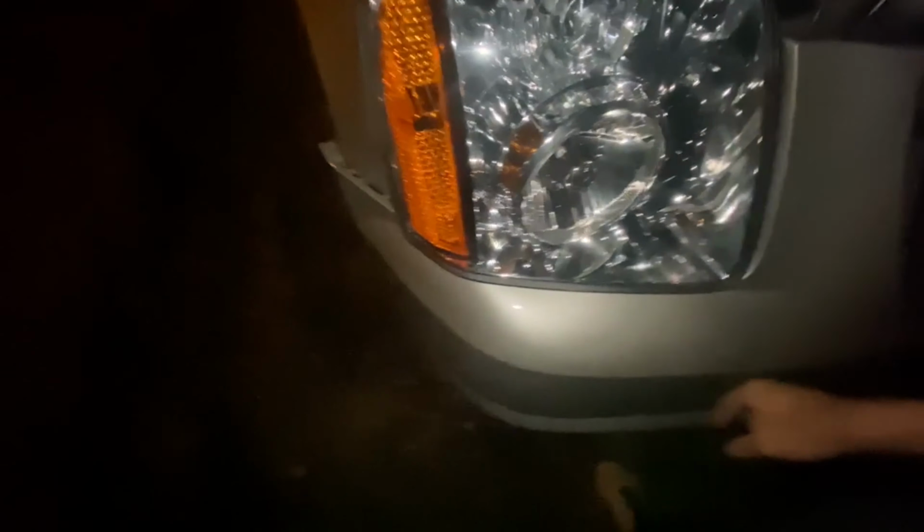So yeah. All right, boys, so after a good little time, got the grill pretty loose. This one is clear. We're coming over here. Bam, got this headlight out. So you gotta go in here, take a little 7mm bolt out there. The rest are 10mm right here and here. If you see in here, there's also that one bolt that's hanging there. It connects to the headlight, but it's really not useful at all. It makes a pain in the butt to undo it every time.